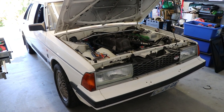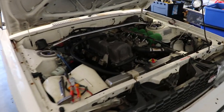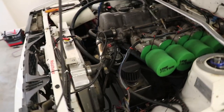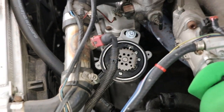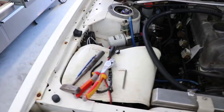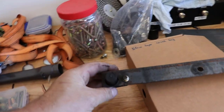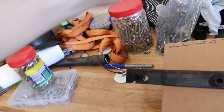So we have some Easter shenanigans going on in the workshop, working on the 910 Bluebird. I mainly wanted to get rid of the existing ignition timing system, which was a 36-in-1 toothed wheel on the front of the engine. This was the pickup that picked up the 36-in-1 toothed wheel — an inductive pickup.